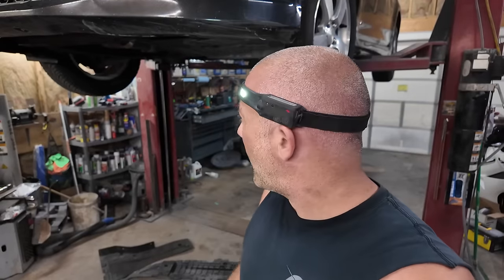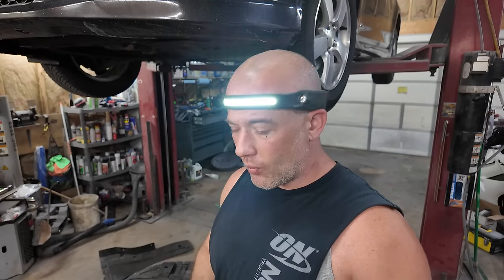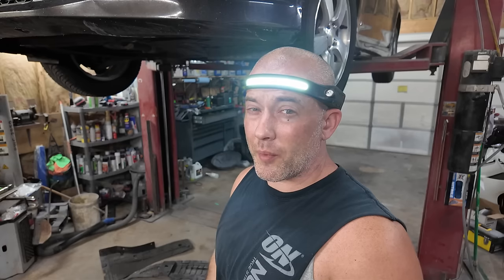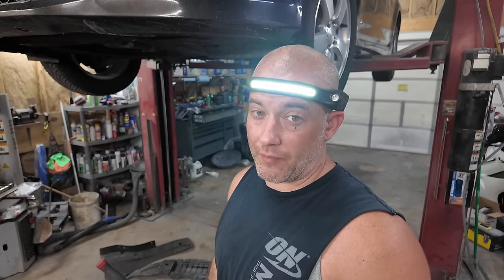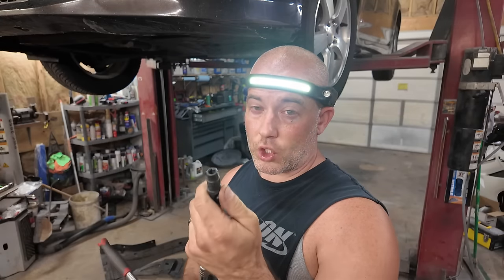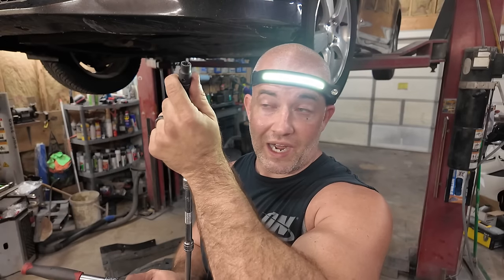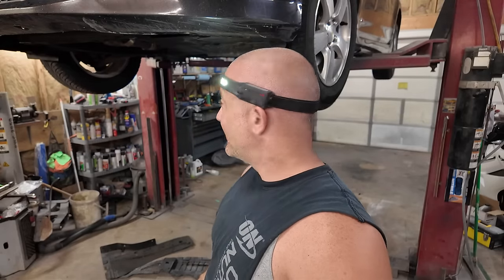All right, we've been running her for quite a while now. Went around, tightened some oil pan bolts because it looked oily. You know, I've cleaned it off, but it just looked like there was some fresh oil there. Went around and honestly probably got like six of them a half a turn or more tighter. Maybe one, maybe a full turn. And then the oil drain on the turbo, the front bolt was loose. The one that's hard to get to, you need a swivel socket and a couple extensions. You can get to it. I got about 3/4 of a turn on that one. It shouldn't leak very bad if it does now. It's just rust proofing at this point.